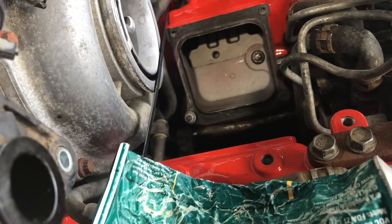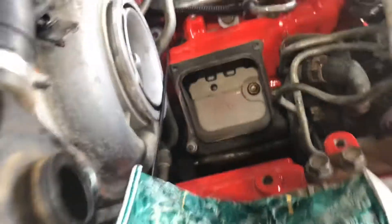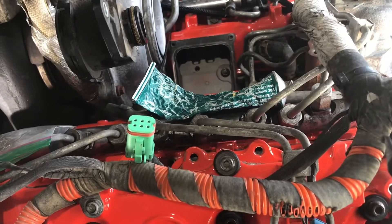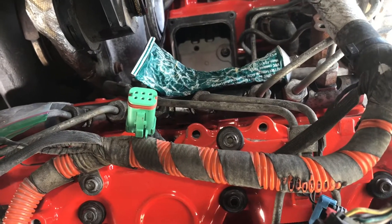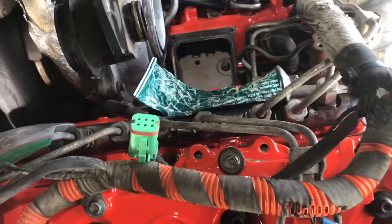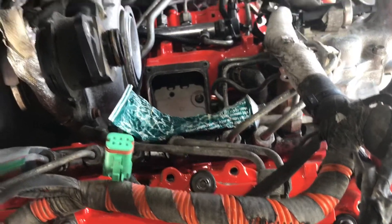After that, I'll get up to the Y bridge. I'm going to put my stock Y bridge back in. I'll clean all the carbon out of it — it is really plugged full of carbon. Everything else is nice and clean. I'll clean the carbon out of the stock Y bridge, put some new O-rings on, and stuff it back in there. Someday when I can afford it, I'll buy a different Y bridge.